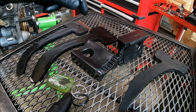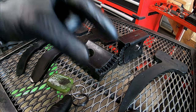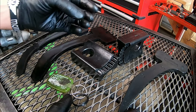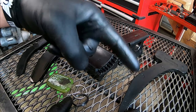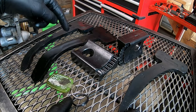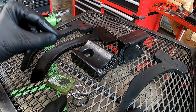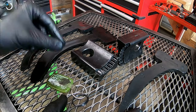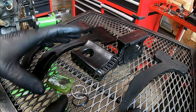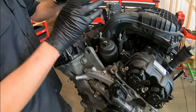Over here we've got different wedges. These will be pressed against the chain guide and will press up against the hydraulic tensioners. Some of them work slightly differently, but once they're compressed, it gives us the necessary slack we need for pulling the cam phasers off. These are for the right side, that one over there is for the left side, and this one is for 2011 only — this one is 2012 and up. Now these right here are specifically for the variable valve timing VVT engines. Later model 3.6s had variable valve timing and variable valve lift and use a completely different set — they look similar but some are actually metal and not plastic, and the wedges are also different.